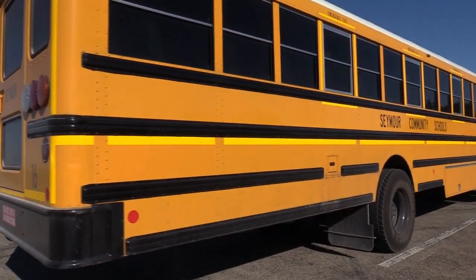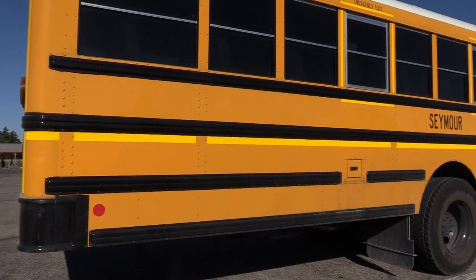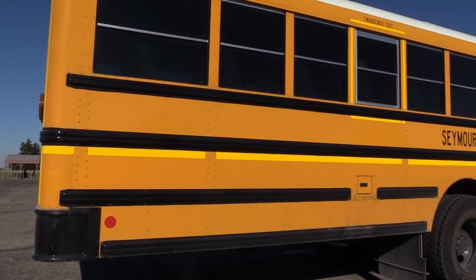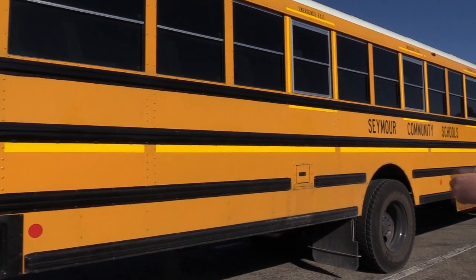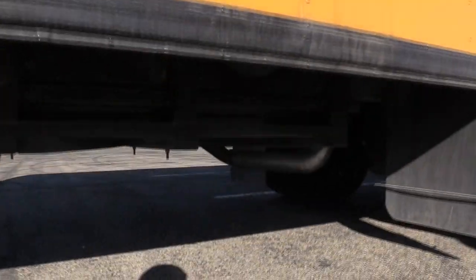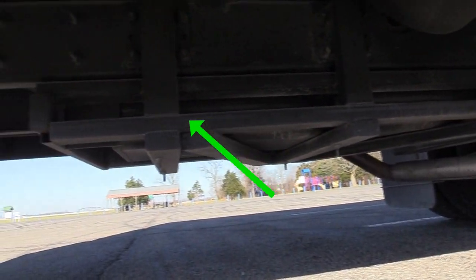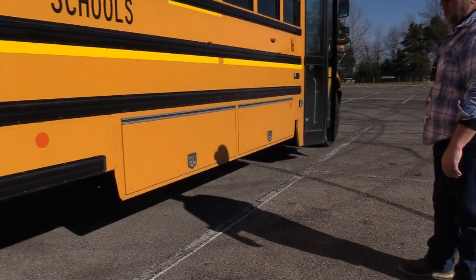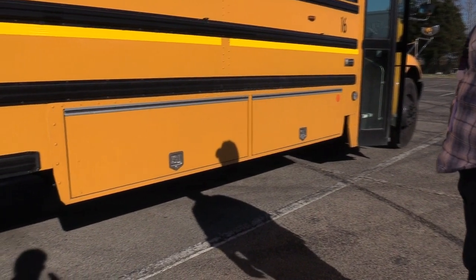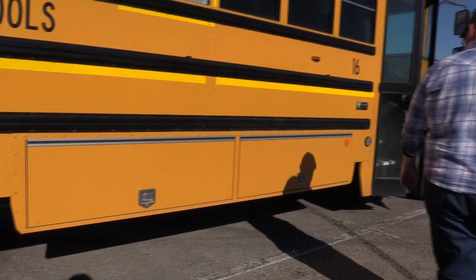Now the differences for the side of the bus: I'm going to check my fuel tank to make sure it is mounted and secure, the cap is in place and tight, and there are no leaks. I'll also check to make sure my impact guard is in place, mounted, and secure. I'll check my luggage compartments to make sure they are in good condition, open and close, and latch properly — the hinges and seals are in good condition with no unapproved items.